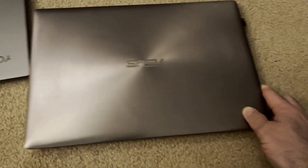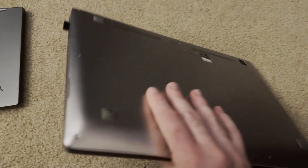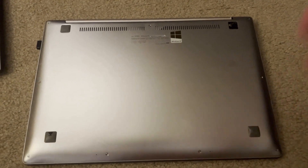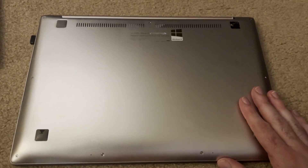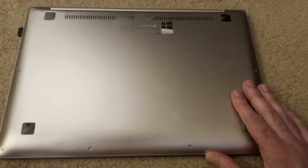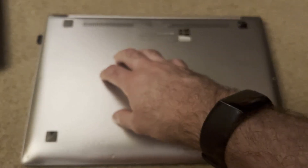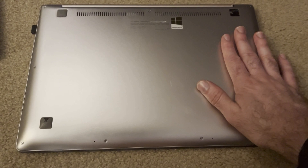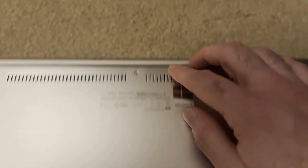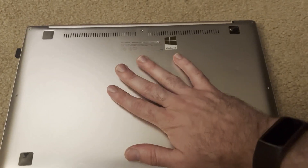The first laptop in testing is the Asus U303 ZenBook. It's quite an old machine by today's standards — it has a 4th gen Intel dual core pulling a maximum of 15 watts, and the GPU is the M840 which can pull 30 watts, so that's 45 watts total. The reason for using this in testing is it has an aluminum body, and I attached thermal pads to the heat pipes and to the bottom of the chassis for extra heat dissipation.